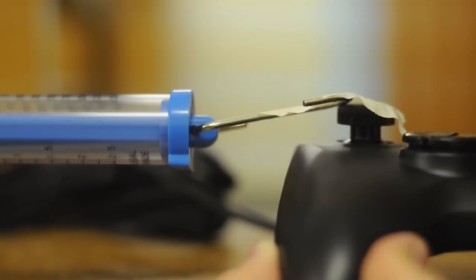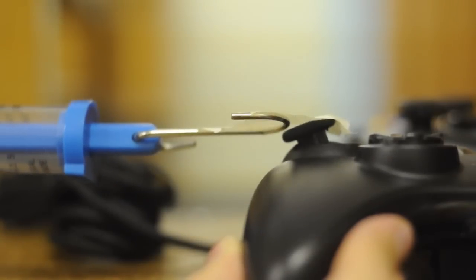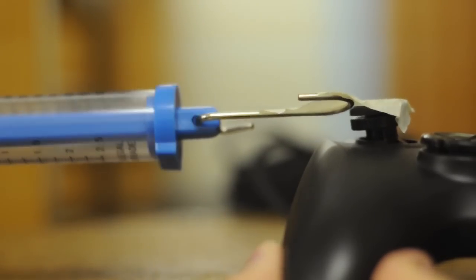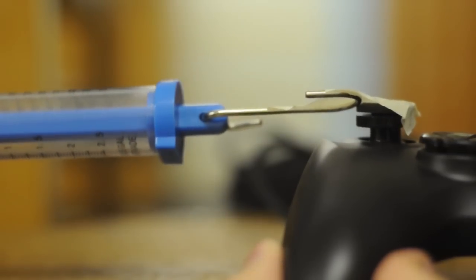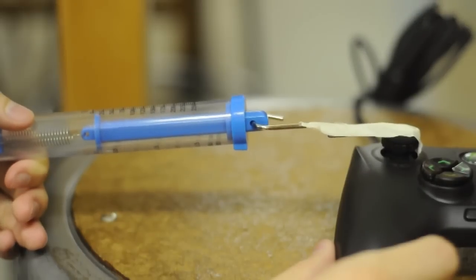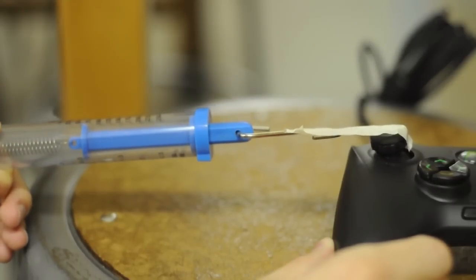At the lowest setting, the stick moves smoothly at approximately one speed with a consistent 50 grams of force — very similar to the Microsoft controller, except the Microsoft controller requires a bit more force and isn't quite as smooth. But look what happens when we bump up the resistance on the Anza. At 15 clicks, the closer you get to the stick wall, the more force it takes to keep going at the same speed. It becomes exceedingly difficult to get the stick all the way to the wall, especially moving it left on the left stick. Even at lower settings, it takes hundreds of grams to make that final push. It's kind of like pushing in a sponge or a mattress — easy to push in a little, but progressively more difficult the more compressed it gets. This is the same as stretching a rubber band or spring, something I became aware of when I used to do internal modification of Microsoft controllers to increase resistance.